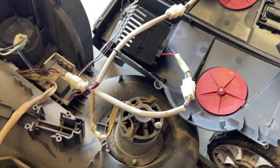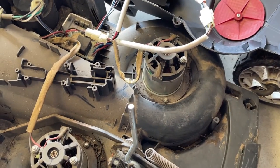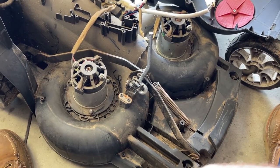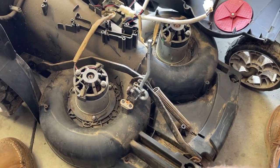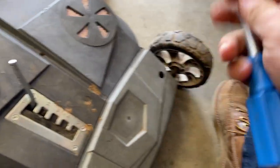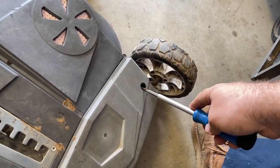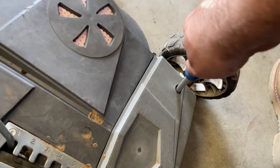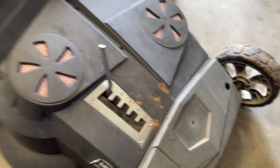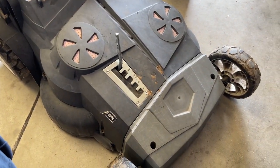It's really interesting that they know people are going to leave this stuff outside. With wet grass, it's going to find its way in here no matter how well they try to seal it. There's no stopping wet grass from coming through, especially up through the motor. The bottom of these motors have breather holes, which is another big issue I have with electric lawnmowers based on how they operate in a wet grass environment. I'm spraying white lithium grease onto the metal-on-metal contact points for the leveler system and buttoning the top cover back up.